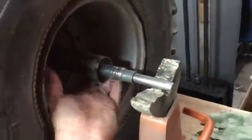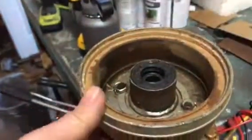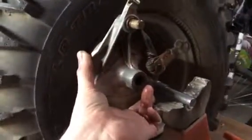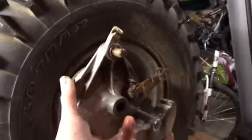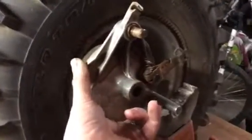I thought, why can't I put a hub on this side — another three-wheeler hub with another hub? So that's what I'm going to do. With this hub I'll cut the welds, get the hub plate which is underneath off of there, use this hub for the brake. Here's the drum brake — I'll have factory Honda drum brakes in the rear. I'll just weld it on here, with the shaft going through the center. That's the idea and it's going to work no problem.